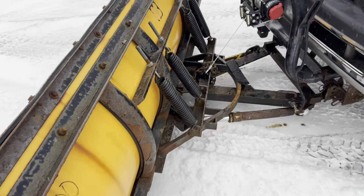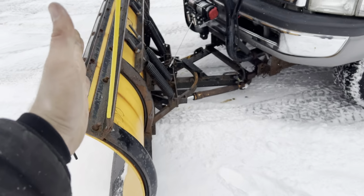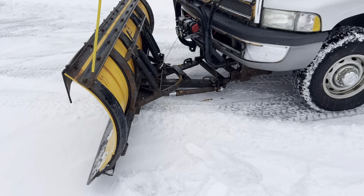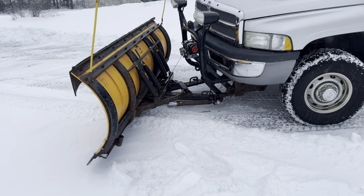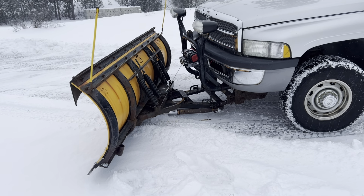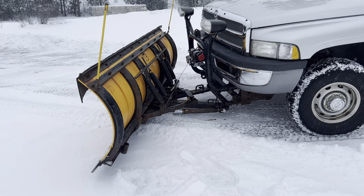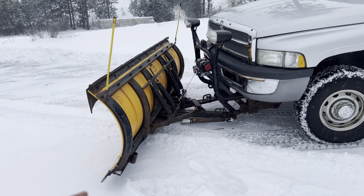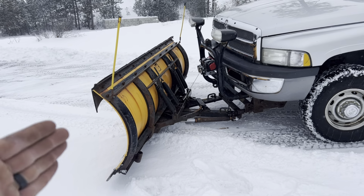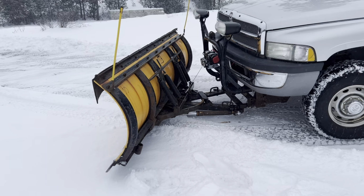Also, you guys had me wondering, what's gonna happen now that it's gonna tip? Well, I've noticed that on some home plows, they don't just stay straight, but they don't have a control for the oscillating or whatever it's called. So I'm gonna leave those old hydraulics on there, and then whichever side is heavier, it'll push to that side. So I think that'll work.